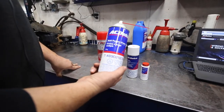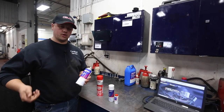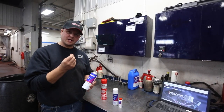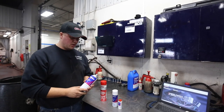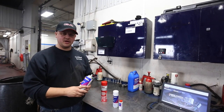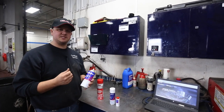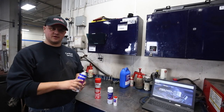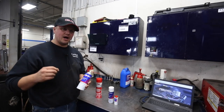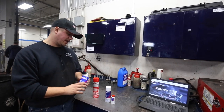This next product is multi-purpose grease. Something is better than nothing when it comes to lubing up your door hinges and door latches. Anything you've got at home will work. This stuff is good because it's a thicker, waxier grease — when you spray it on, it sticks and stays. You can use your Rust Check green can, red can, or WD-40 products. The advantage of this waxier grease is it doesn't stay as sticky, so it doesn't tend to grab and track dirt. A more liquid-style spray means dirt sticks to it, gets into the grease, and then you've got stuff making noise and wearing parts out.